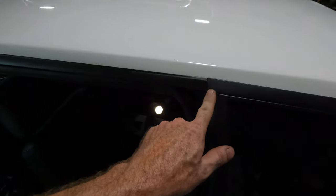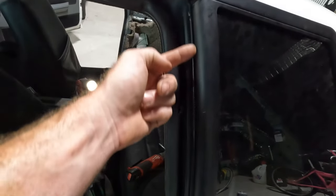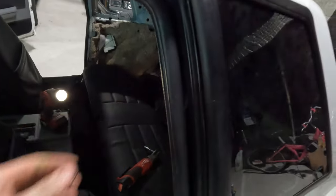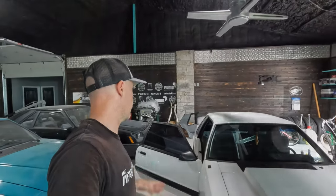We are good — nice and tight along the quarter panel, top and bottom. The fitment looks good here. This one area might not be 100% due to the mold not being cut perfectly, but the main thing is making sure the seal is good. Make sure your butyl tape is 100% sealed all the way around. A trick you can do is shine a light from the back side or from the front to see if you can see through. You can see the light shining through right there, so I'm going to get some more tape and make sure that spot is sealed.